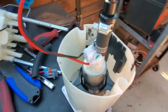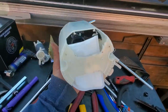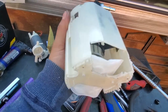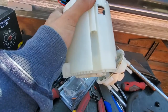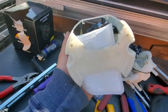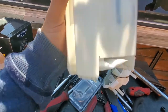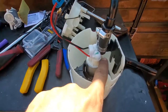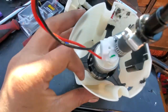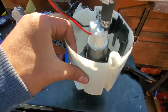All right, so this is how we look now. You can see we put the filter on the bottom. You cut it like this. I'll put a link down below in the description on how you're supposed to cut it, but don't cut the whole thing. Make sure you leave this side right here, just so it gives some space and the float does not bottom out, or else you're gonna get bad readings. Put the filter that comes included like this. Make sure to put the outlet towards this backing plate right here. See how it's like that? You put the plastic on and slide it down, and it's right there, secure.